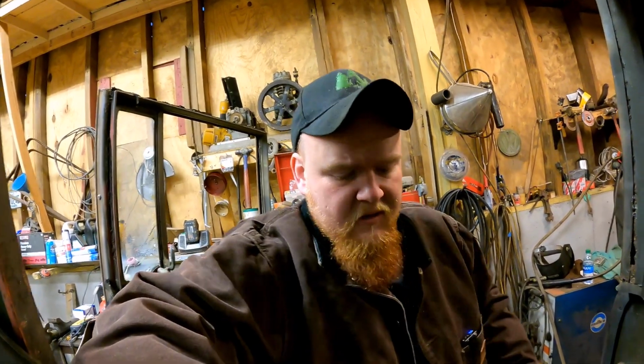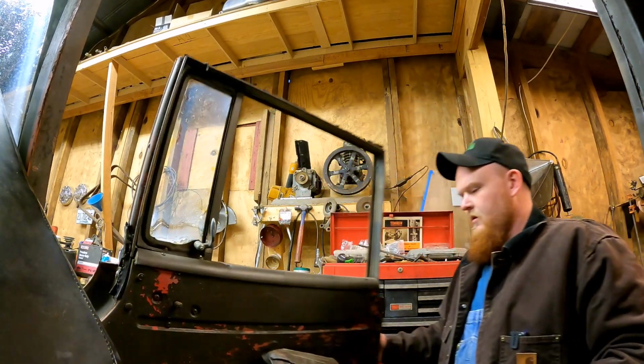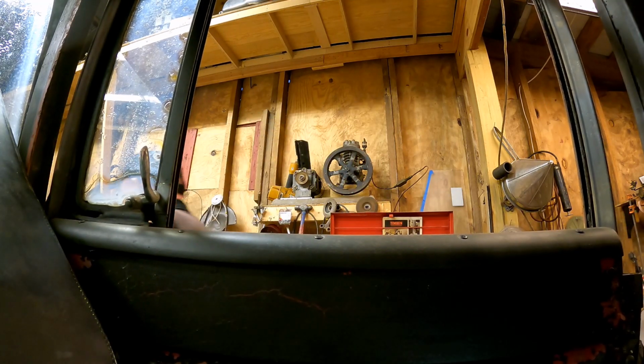But let me sling a battery in this thing, and we'll see if we can't get her to cooperate again, at least for a moment, before I start tearing crap off the engine. I got to order some new spark plug wires, order some points, pull the carb off. And I'm going to try to film all that crap. But I can't even work a tripod for a camera, so you'll probably have to be patient. Don't get emotional, alright? Hang on a second. Look at this truck. It's awesome. Let's see here.